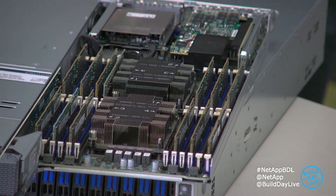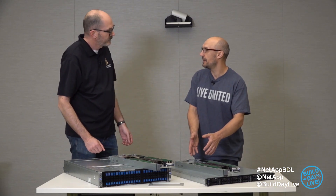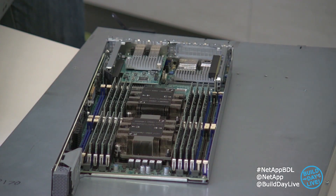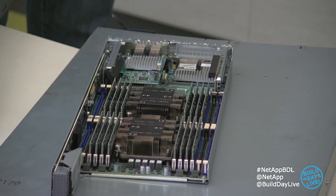We also have a compute node here. Looking from the outside, we're missing the NVRAM — we don't need NVRAM on the compute node, it's all done in the storage layer. We also have an extra NIC card, which is specifically beneficial for our vSphere environment. You might want to dedicate 10 gig NICs for storage in some use cases and have the others for virtual machine traffic, or mix them together. Customers are deploying compute nodes with a lot more memory and more CPUs to match their workloads.